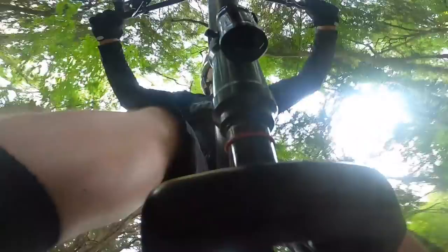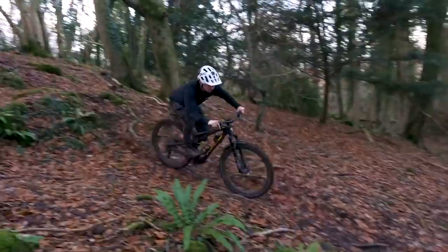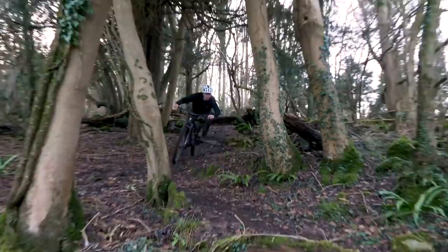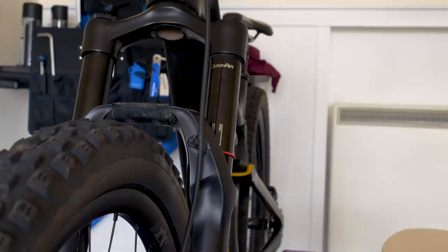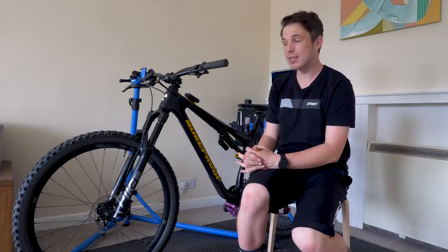If you want to start experimenting with making your own bike slacker, a good place to start can be some offset bushes and an angle spacer which sits just below the head tube — it can take about half a degree off the head angle. So the final question is: is it worth it? Well, I think the XC mode is really worth exploring, especially with the shorter travel fork. You can pump up your shock harder and largely cheat the system there, but one thing you can't do is steepen the head tube angle by pumping up your fork — so that is really worth visiting.